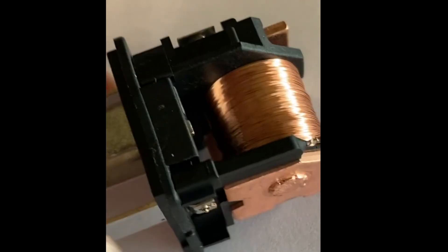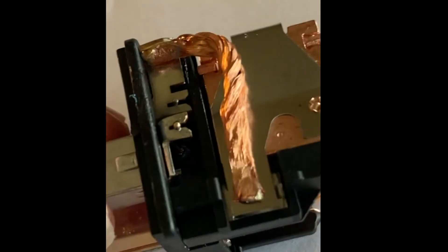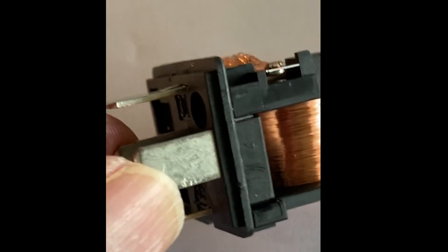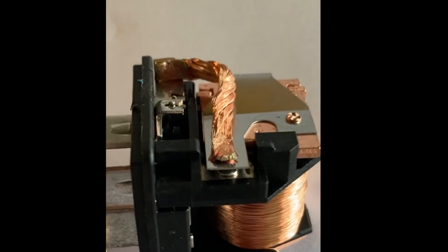The entire power is going through that one relay contact — that's probably the weak point, based on reports of contacts being burned. The coil is connected on both sides, and the diode across the coil is right here to protect against back EMF from the coil. But there's nothing doing any arc suppression on the contacts themselves, so it's a pretty small failure point. These two contacts are actually connected — that's the relay output on the other side. Fairly simple design, nothing complicated, but just one small single contact to run all the current to the fuel pump is probably the failure point.